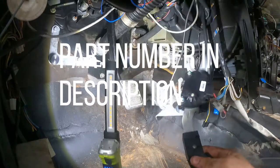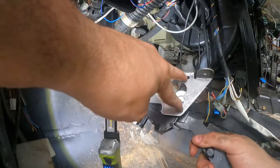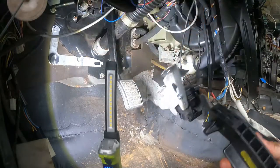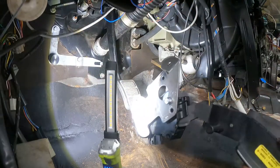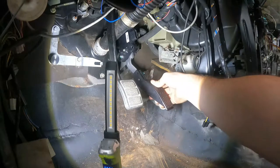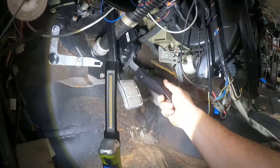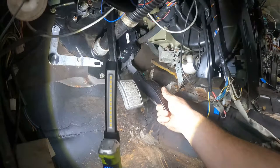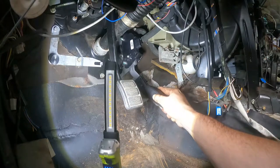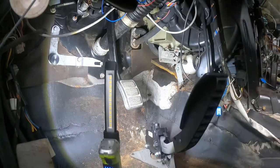This is the GM Performance pedal that I ordered. This part had two mounting holes here and here, but whenever I put it up on the surface, the pedal almost pointed straight down into the floor — it was way down. So I swung it out, drilled a new hole, and put in some spacers so that the brake and the accelerator pedal are at the same plane. I just need to figure out how to get it mounted — I may have to put in some spacers or make a little bracket.